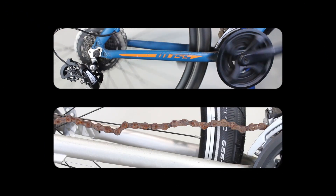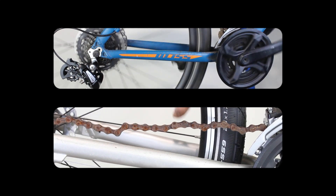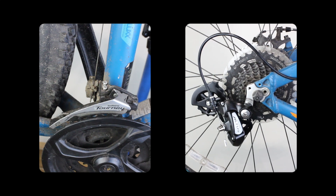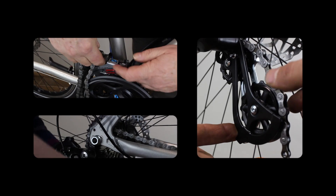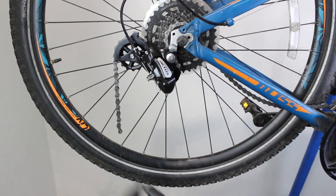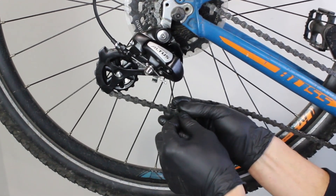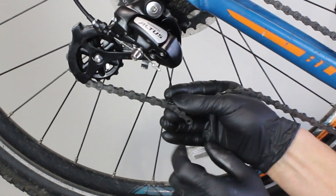If your chain is missing or very stiff and rusty, it will not be possible to use your old chain as a guide, so you will have to assess the correct length. Move the gear shifters so that they put the derailleur on the smallest cogs front and rear. Feed the chain onto the bike — we have a handy video here to help you. Hold the end in your right hand so that it is between the rear and front cogs, then pull the rest of the chain in your left hand so that there is a small amount of tension on the chain and the rear derailleur is parallel to the floor.